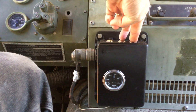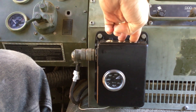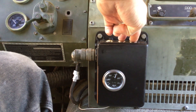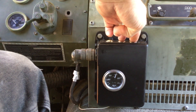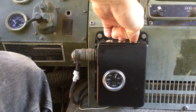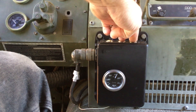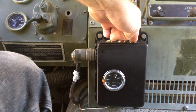If I want to inflate, press the supply button while holding control. You'll see it jump up a little over 80 PSI, and the needle will come down to a couple of PSI above what the actual tire pressure is — five or more PSI is what I've been seeing. You'll see it slowly creep up when draining out the wet tank, and then it'll stop moving when it gets down to where the protection valve stops letting air out of the wet tank.